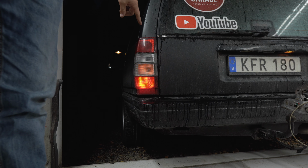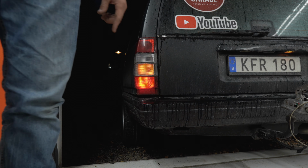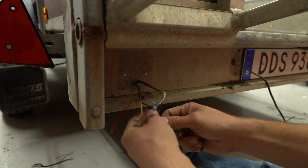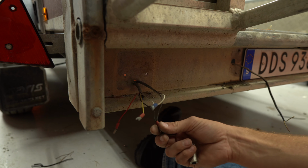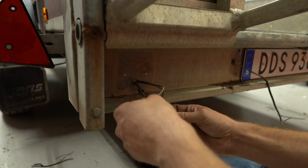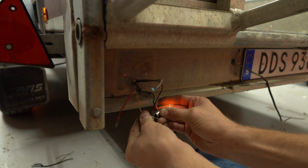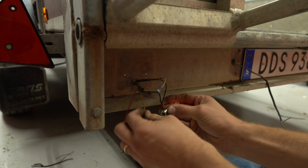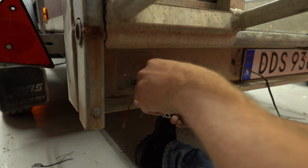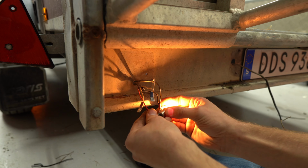All right, so we have the taillights on, left blinkers. Let's go see which wires are what in the back of the trailer. You can use one of these lights that came off the blinkers from the old lights. Black one, I'm just gonna go ahead and assume that's ground because it's black. And we'll just put that against the casing here. And then we'll check and see. Yeah, like I told you, the green one, or whatever color this is, is the blinkers, because it's obviously blinking. And then we have the tail light. Yep, so then this.